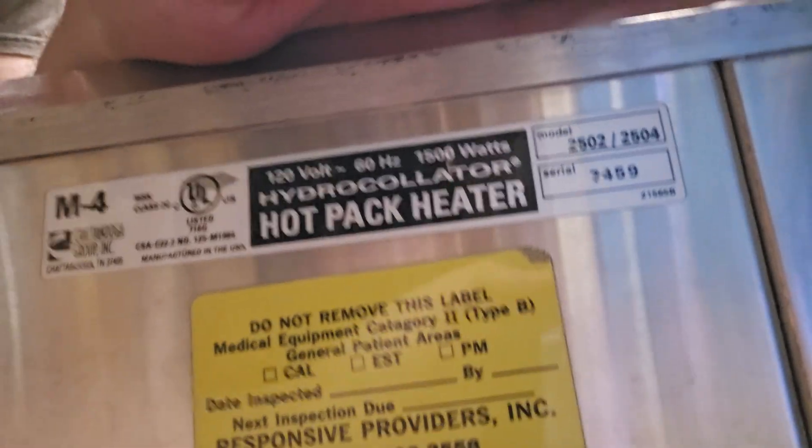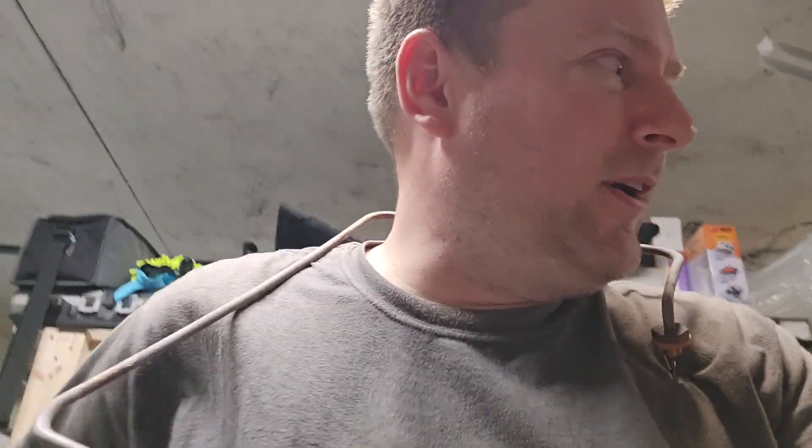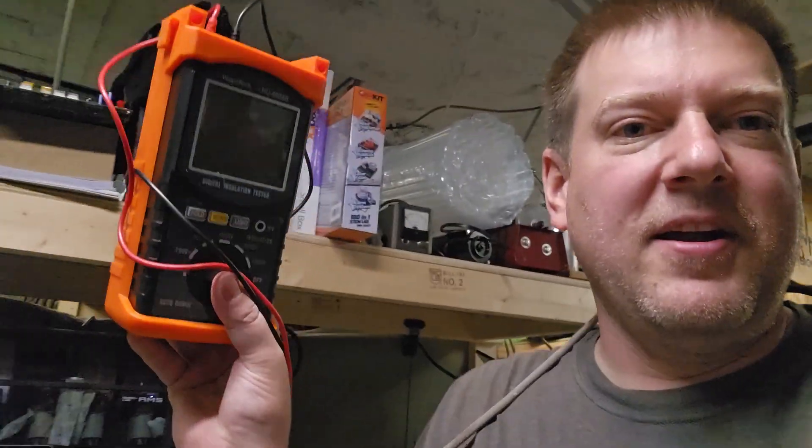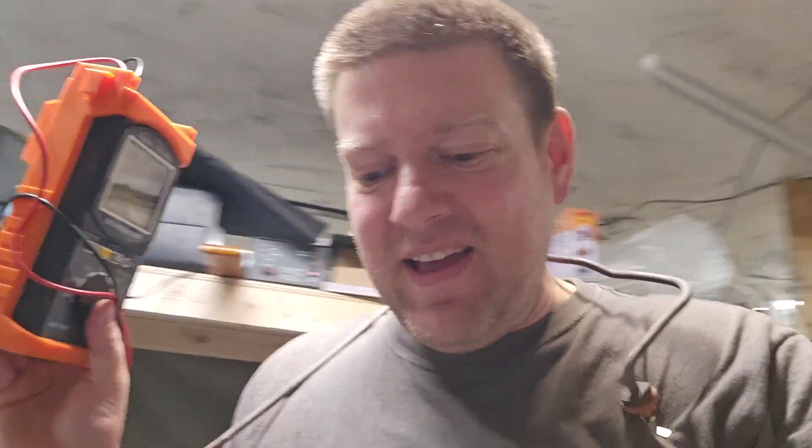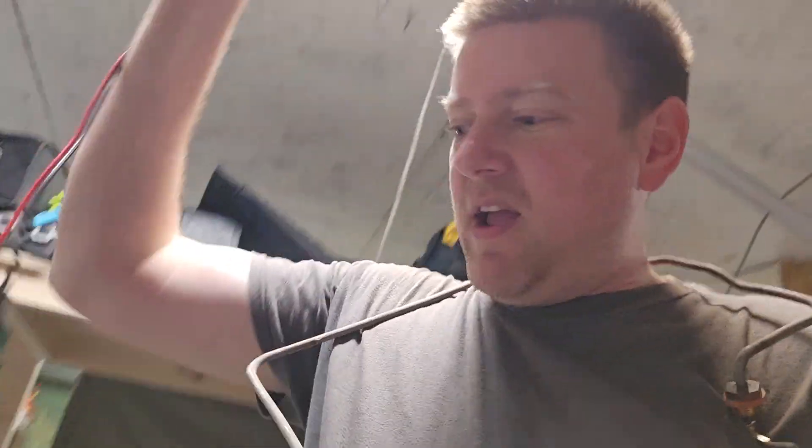Some units say 1000 or 1200 watts, but this one clearly says 1500. Anyway, if you ever experience something like a broken power switch, go ahead and check your equipment current. In this case — something I had never seen before in my career — I had a heating element with some sort of internal failure. I ran it with an isolation tester, which is a dangerous little fellow. I was doing an isolation test before I put power to this unit, hooking up the isolation tester leads to the power cord.